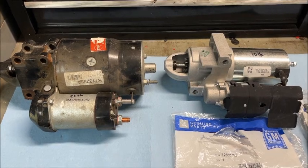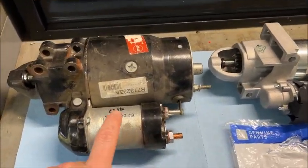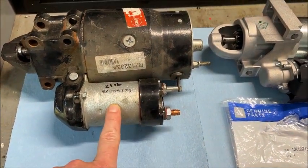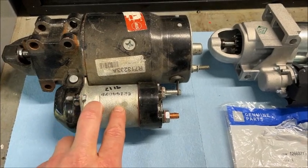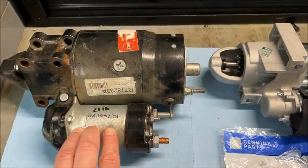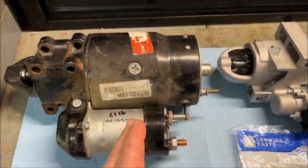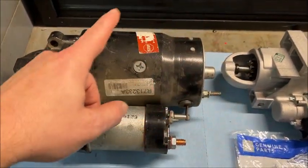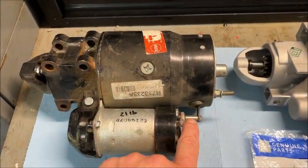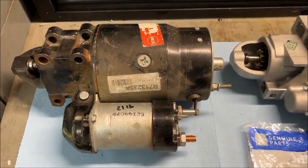...turn the key and there's nothing — nothing at all, not even a click. That's because the solenoid windings, being right next to the exhaust manifold, have gotten very hot. When things get hot they don't flow energy very well, because there's already a lot of energy in there and there's just not enough voltage by the time it goes from your battery all the way to your ignition and back out to this little terminal right here — just not enough voltage to push the current through.